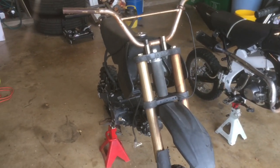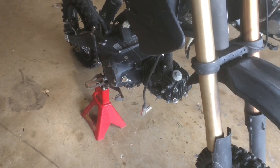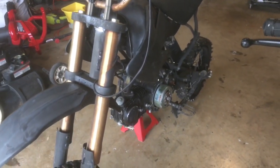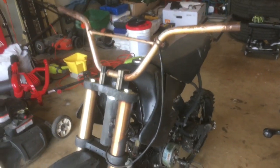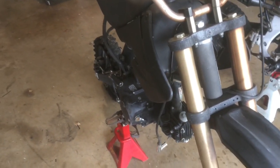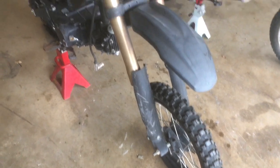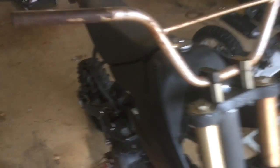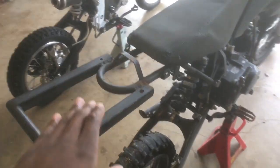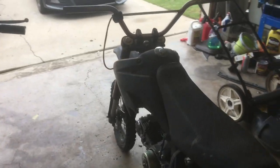For the most part everything is all there — pretty dope. I'm not too sure what parts I'm going to be keeping, but the motor has compression; all it's lacking is a carburetor. Get some gas through it and she should crank up hopefully. We will be going through the motor, cleaning it up, and changing the oil. Long run, I'm hoping to put either a 140 or 160cc in there. I'm not too sure about spending the money on a Daytona 190, which would be nice, so if anybody has a Daytona 190 they want to sell me cheap, let me know. This bike is pretty much complete — it's just lacking plastics, and I've got to get rid of this 12-bar. This is going to be a race bike, so it's got to go.